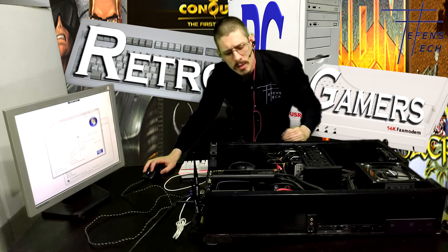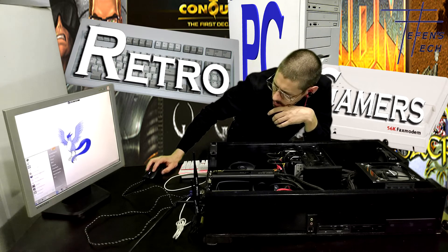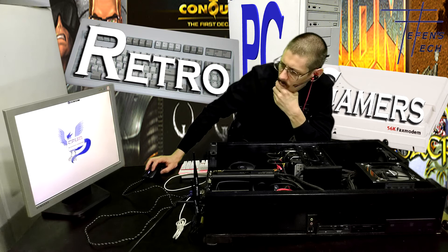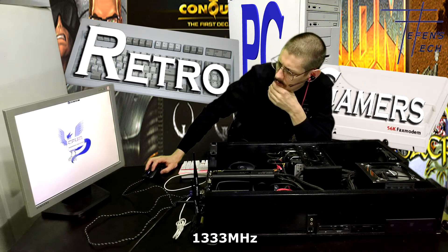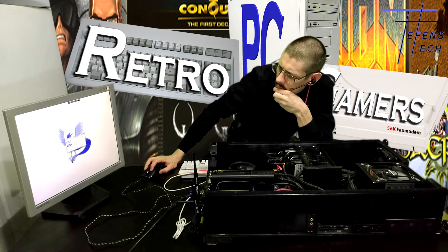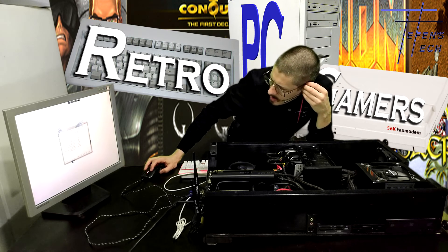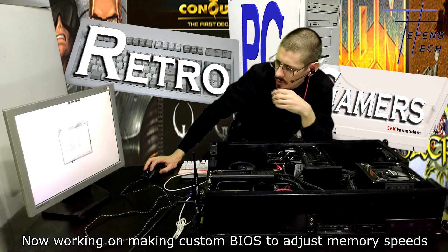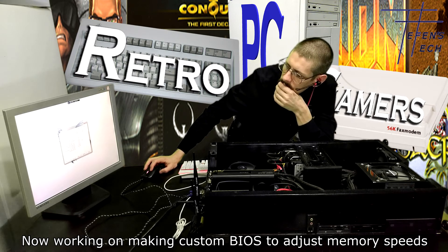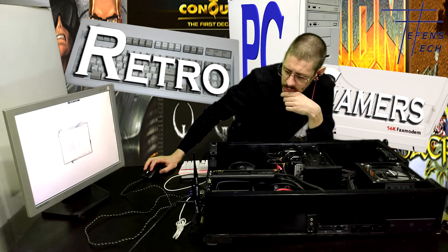I hope you learned your lesson on low density memory today and enjoyed watching the show. Let's check CPU-Z real quick before we go to see what speed it's running at. I was hoping it's working at 1333, because previously the 2-gig chip was having a problem only running at 1066 on this board. Unfortunately, I can't change any settings in the BIOS and there are no custom BIOSes I could find either. Oh no — 530 times 2 is 1066. It still doesn't want to run at 1333. That sucks.